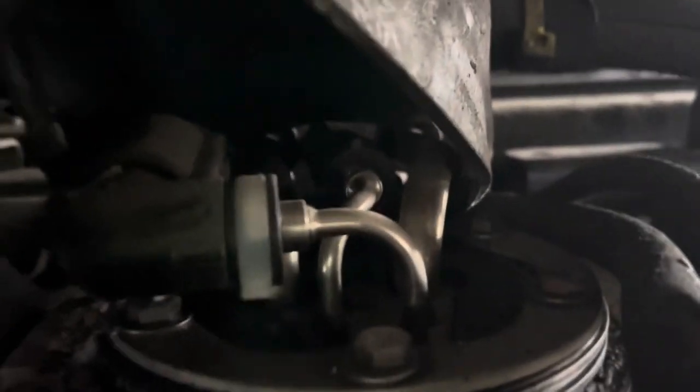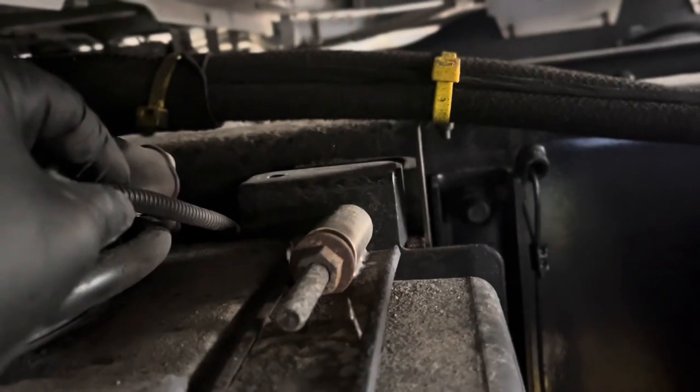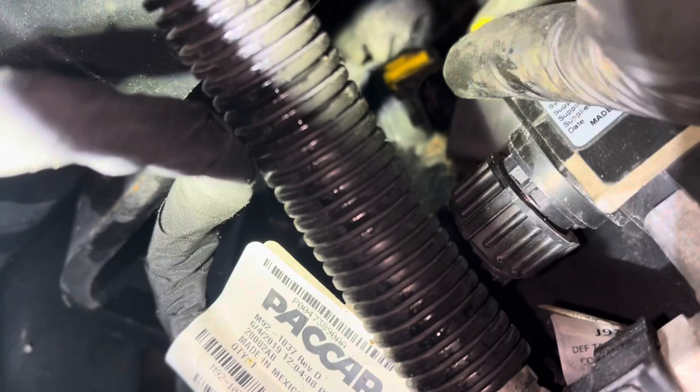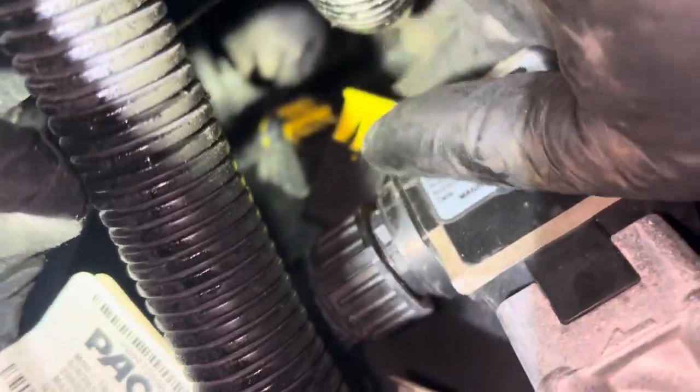Even this — this is your DEF lines and your coolant lines. But the leveling sensor is right here. So I got to go underneath and disconnect this cord. This is the sensor plug right here. Lift this yellow tab up. Be careful if you can — it is fragile, it can break.